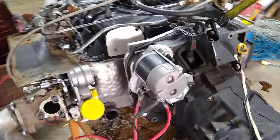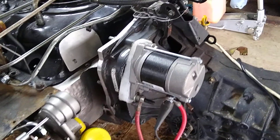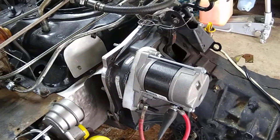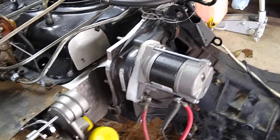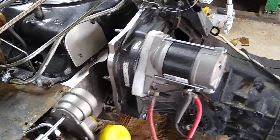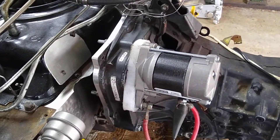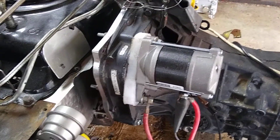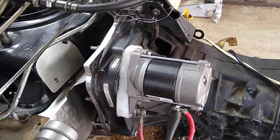The question is how are we going to start this thing. It turns out that Honda, with their counterclockwise engines, needed a clockwise starter as well. The solution is a '98–'99 Honda Prelude starter — clockwise, nine-tooth — and a nice little adapter plate. That's a white piece of material, three-quarters of an inch thick, an inch block to begin with, and very simple to machine and make up.